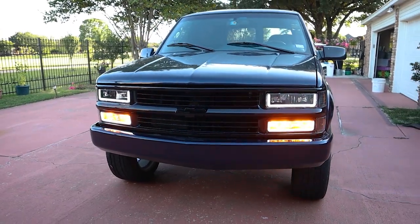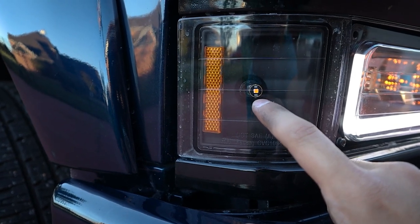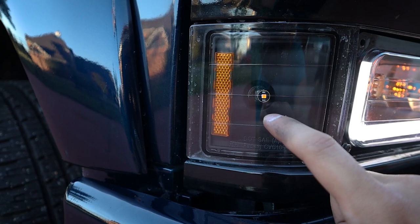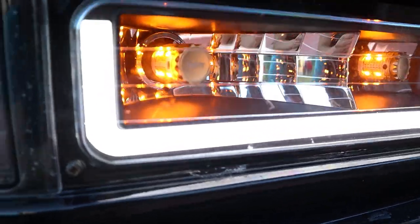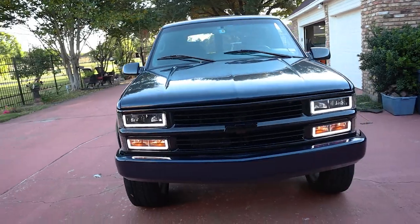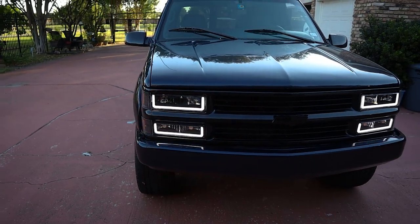Let me turn on the hazard so you can see how they're looking. It's really bright — as soon as they turn on you really can't see any details in the housing. I also used a Sharpie to black out the plug on the corner lights since it was a whitish color and very distracting. You can see up close these aren't even flashing — this is literally just them on steady. Now as for the turn signals, you need to let them run for at least around 30 seconds because as soon as I plugged it in there was a hyperflash, but after about a minute it went away — just a little activation thing. The hyperflash is completely gone and both turn signals are blinking normally.